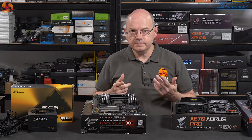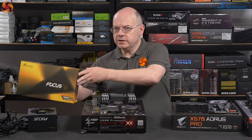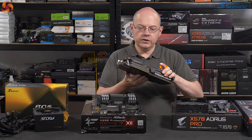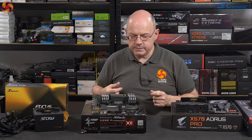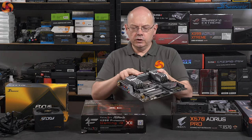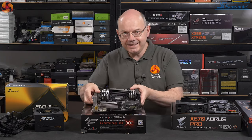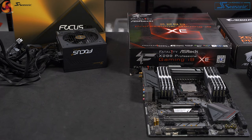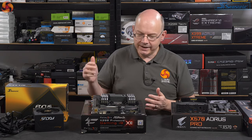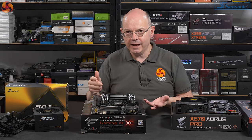It's time to build the first test PC. I'm going to use the same hardware inside each of the four cases so we can compare thermals. Power supply: Seasonic Focus Plus Gold 1000W. Graphics card: Asus Vega 64 Strix — a nice big card that takes up a lot of space. Motherboard: Asrock X299 Gaming i9 with a big heatsink on the VRMs, an 18-core Core i9 processor, and a load of G-Skill Trident Z memory. It's ATX form factor, which is significant because two of the cases are ATX and two are E-ATX. The problem is the RGB connectors — this board has 12V RGB but not addressable ARGB.